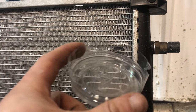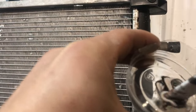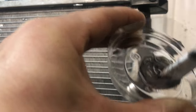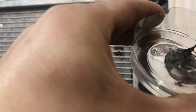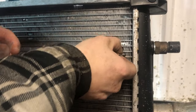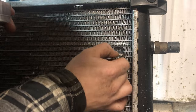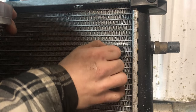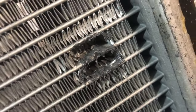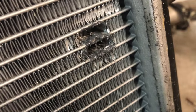I've got a little plastic cup to mix the JB Weld in. You're going to do a one-to-one mixture. Once you start mixing, you have to work kind of quickly because it will start to set. This looks like it might be about perfect — we've got a nice gray paste. Now I'll start applying it. I'm going to be super liberal with it just to make sure I get this whole area nicely sealed. It's not pretty by any means, but I think I was able to stuff enough JB Weld in there to seal up the hole. Now we just have to wait for it to set and fully cure.